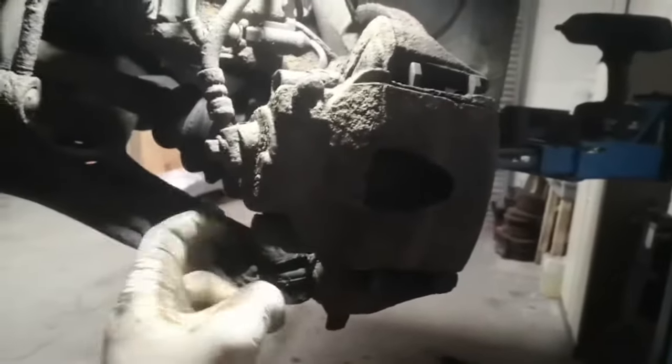I'm also going to have to disconnect the lower ball joint — I think that's an 18 on this one, though it depends if it's an aftermarket lower ball joint because that might be a 19 or an 18. I'm also going to take the caliper off, which is two 7mm Allen bolts for the slider pins because it's a 1.2. The PD130s and GTIs have two 18mm bolts for the actual carrier, whereas these ones have the carrier built in.